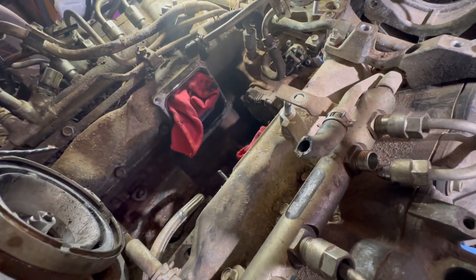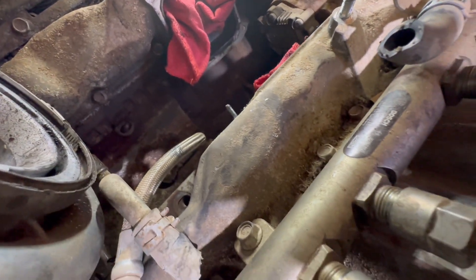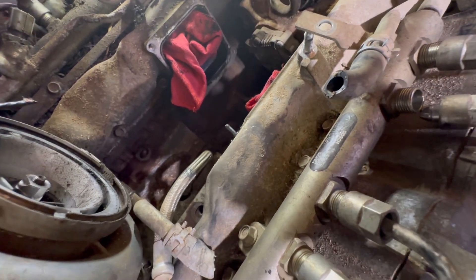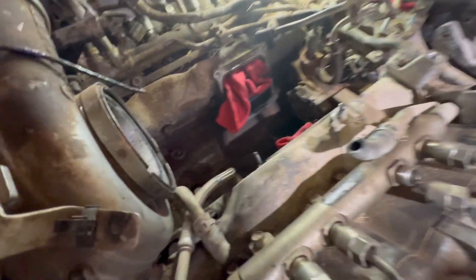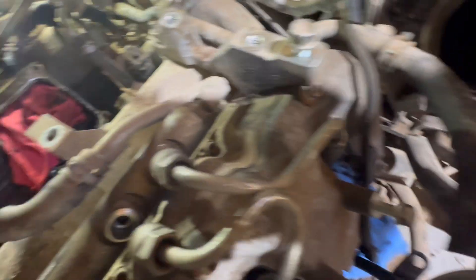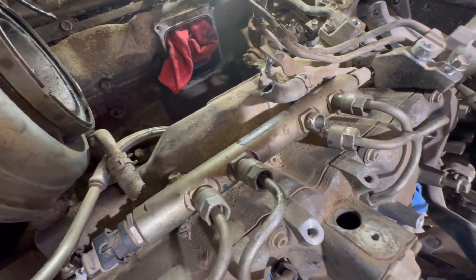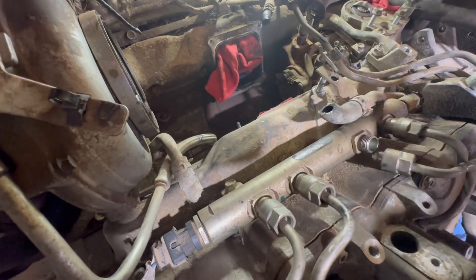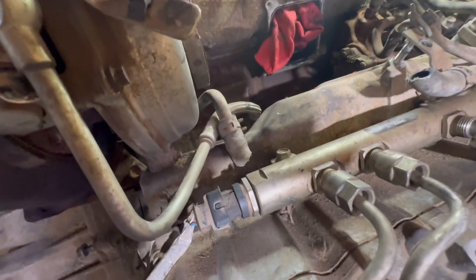There's the Y-bridge removal. Since we're doing the wiring harness and have to pull everything else anyway, we might as well replace it — it all looks pretty old and corroded. The truck sat for five or six years. There was a lot of debris and rat nesting to clean out. Now is the time — I know it's painful money-wise, it's expensive, but you don't have to do it again if you do it right. We'll replace all the hoses and possibly reroute some lines.